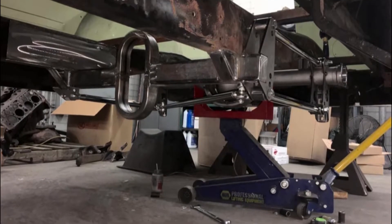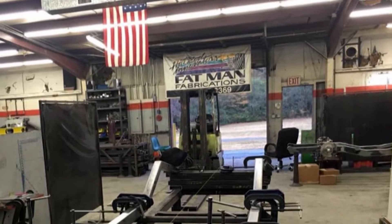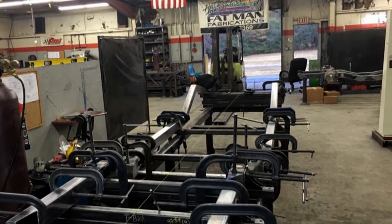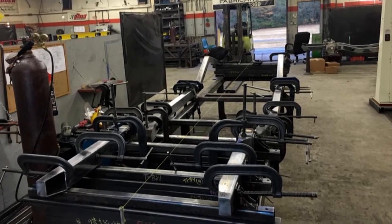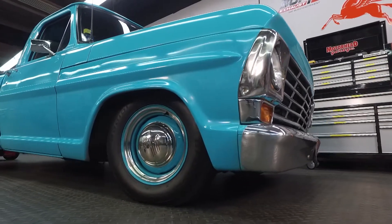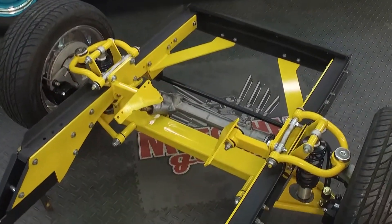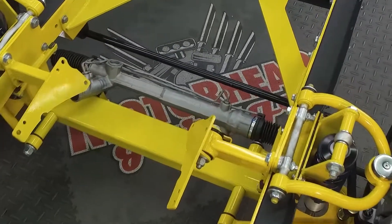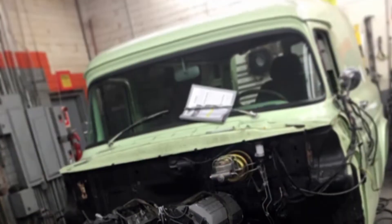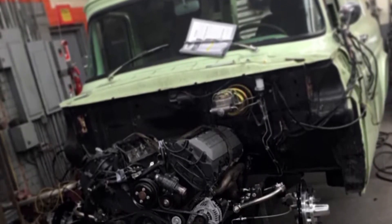What are some of the things you really like to focus on when you're building a chassis? It has to fit right, number one. And it has to be very solid, because no suspension is going to work right if the chassis is twisting. An independent can't do its job if the frame is flexing. So strength is a big issue. Durability and fit are really big. And then putting in a suspension that gives you the right stance, the right track width. The Crown Vic front end on these Ford trucks is an example — stock front end is seven inches narrower than a Crown Vic, so you can imagine the tire clearance problems that creates.